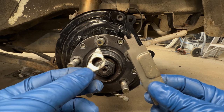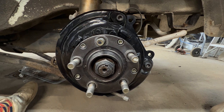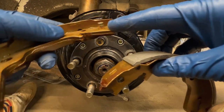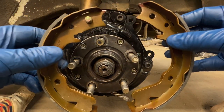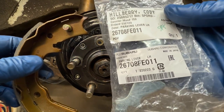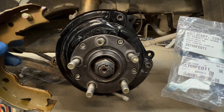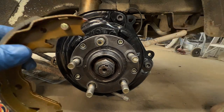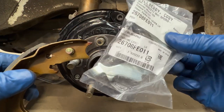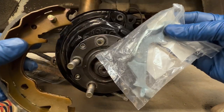So these two pieces you'll definitely need to reuse, but there's one more that, at least in my kit, you need to reuse. If you're looking at your shoes, you'll notice that one of them has a little pin on it with an indent. Here's the part number in case you make the mistake I did, which was throwing away a lot of these pieces. I assumed between the new shoes and the new kit I'd have everything I needed, but you do need to transfer this lever arm from your old shoe onto your new one.